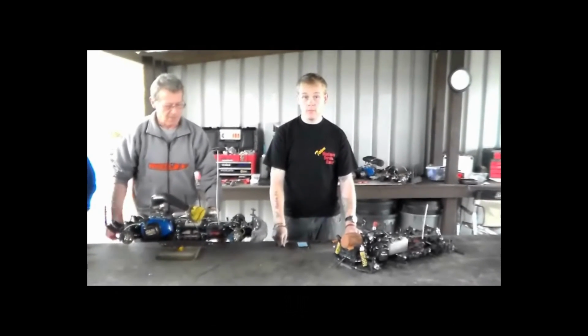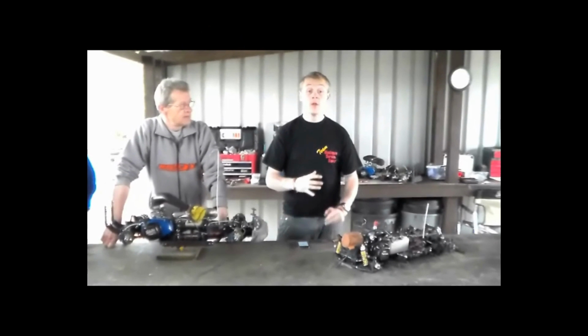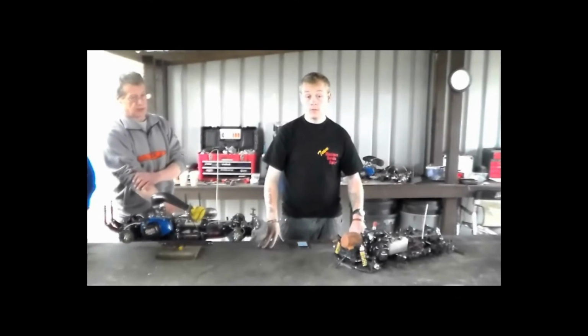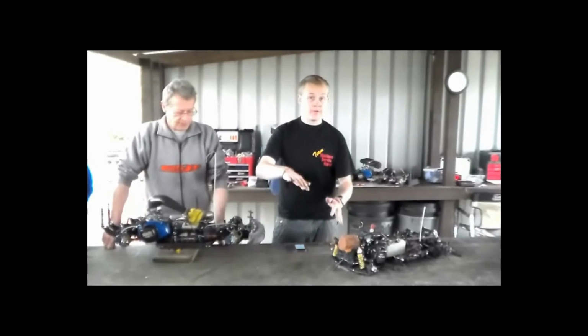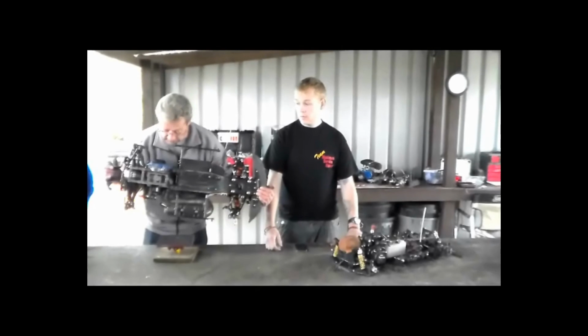And as I said, again, a couple of things like rear toe-in and even shock position, play around with it. You know, the trick is to have as low a ride height as possible, because it comes into the centre of gravity, and we're running 8 and 8, and as you can see, it's still rubbing quite a bit.